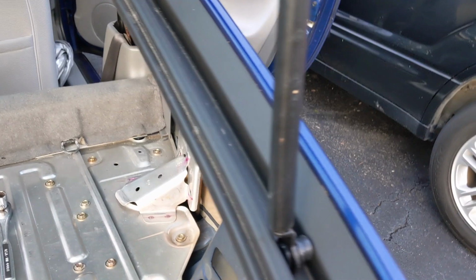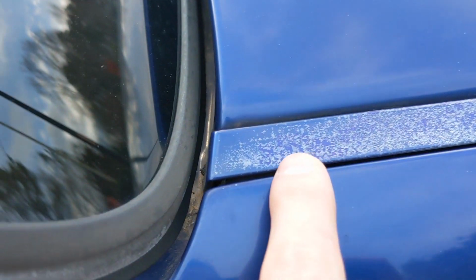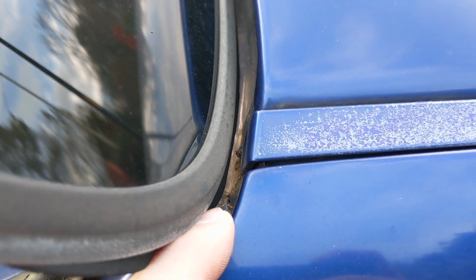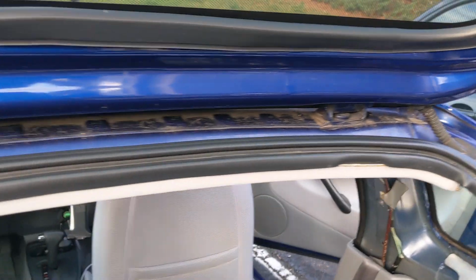My best guess is it's not on the inside, it's on the outside. My best guess is that crack right there. When it totally pours, I get water that runs down here, and usually when it's a light drizzle, I won't get that much water, but if it's pouring, it's gonna go straight into that crack and just flood the whole thing. So I'm thinking it's that one.